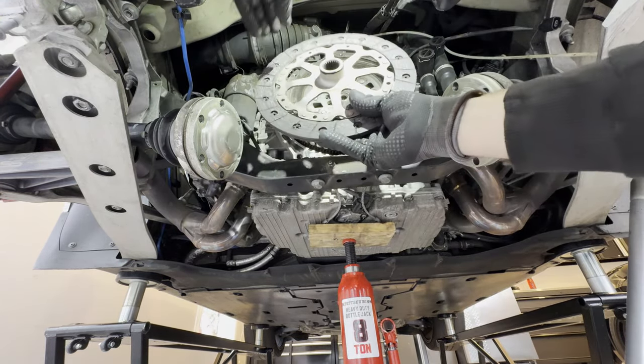Reinstall the transmission brackets. According to Porsche, the bolts into the sub-member need to be tightened to 24 foot-pounds, and the bolts that go into the transmission themselves are 48 foot-pounds. The two bolts on the transmission side are 48 foot-pounds; the two that go through the sub-member are 24 foot-pounds. Install the transmission bracket — two bolts on the side at 24 foot-pounds, then join that to the transmission at 48 foot-pounds. Take the black sensor and run a T40 bolt in there to secure it.